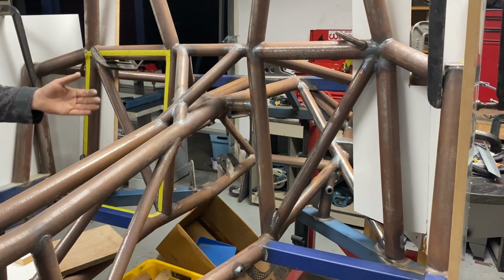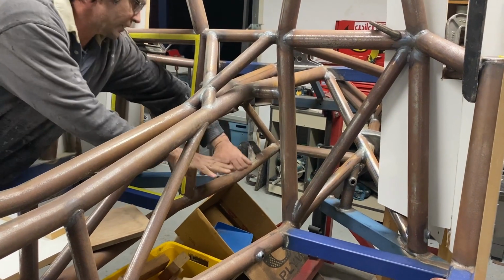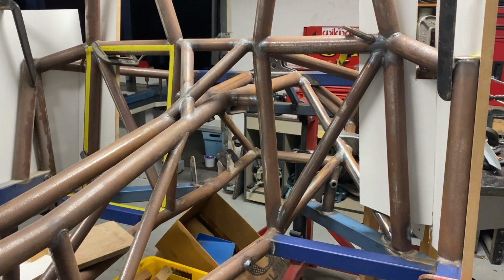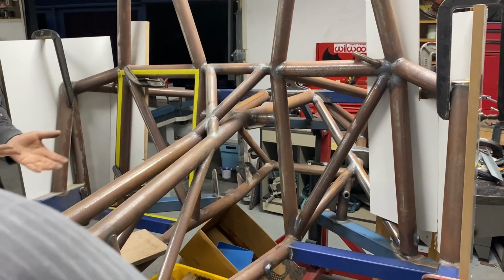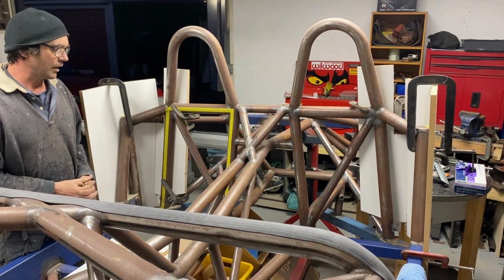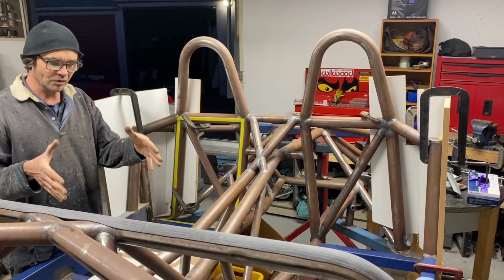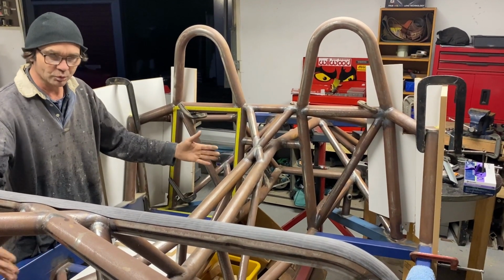The transaxle is out of a late model Corvette and it effectively sits in here. Now, a lot of people, when we initially started building this car, said you just can't do it. You can't fit a transaxle from a late model Corvette into a 1958 car, or C1, and we have. We will show you in the next month or so how we managed to do it. Effectively it's because of the chassis design, and we've done an extensive modification to the front of the gearbox itself and all the bell housings and torque tube.